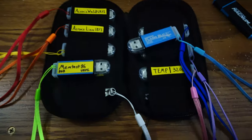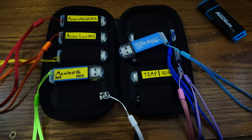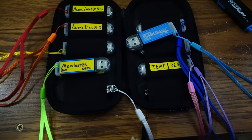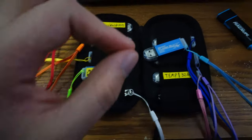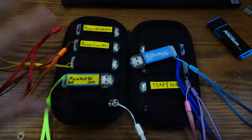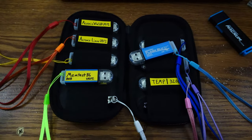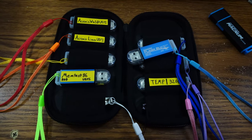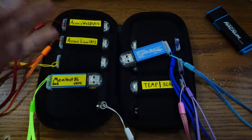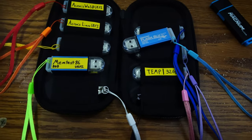I've also tried YUMI — it's been super duper inconsistent for me. The non-UEFI version worked really solid, but the UEFI version is all over the place. Sometimes it'll boot to Hiren's, other times it won't. Sometimes it'll boot to X thing, then after the next update it won't, and they change how it works. It tells you need FAT32 but then it only works if you format NTFS. And FAT32 is limited to 32 gigs, so then it's also limited to 4-gig file sizes, which means I can't put on ISOs bigger than 4 gigs.